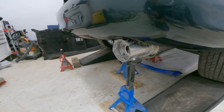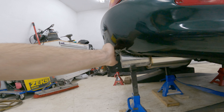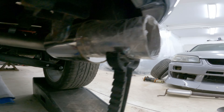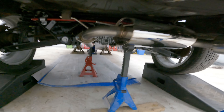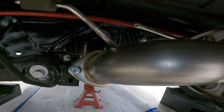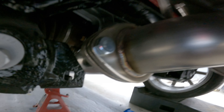So it's now all mocked up. We don't want anything crazy, so it's tucked in a little bit. It's up as high as it can be because the battery tray box thing is right there and I don't want any rattling. The muffler is basically level. Coming over here to the first flange, it's really tight looking to the subframe right here, but there's tons of room in front of it. We can get to the nut, get to the bolt — all that's good.